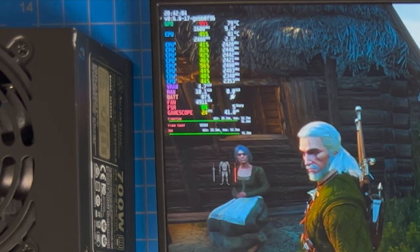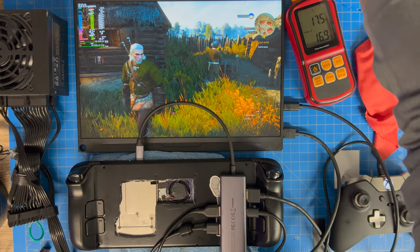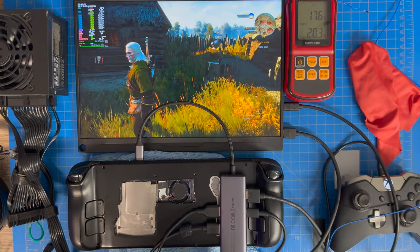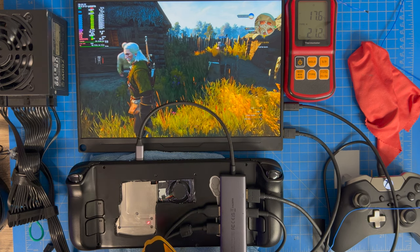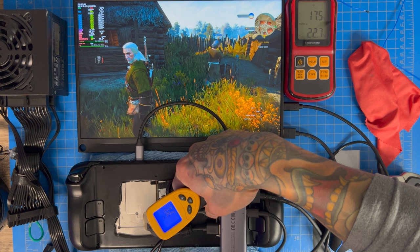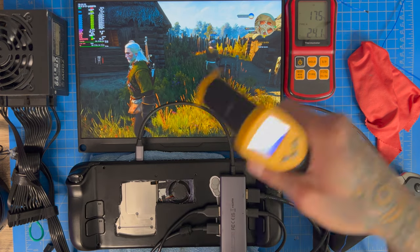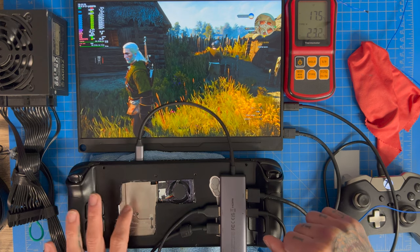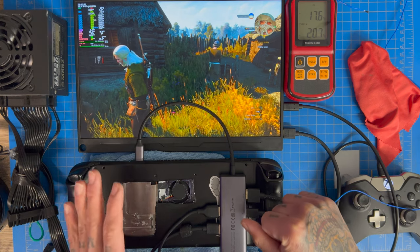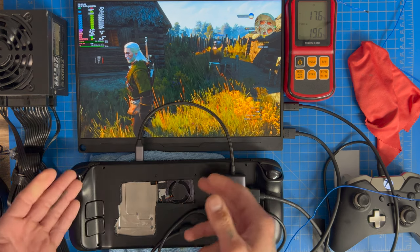We're at 81°C CPU and 79°C GPU, fan speed at 4,900 RPM. Room temp is 17.5°C. Using the thermal gun: dead center of the board reads 26°C; the hotter-running components like the controller MOSFETs and VRM are down here — hottest spot is around 44-47°C where the CPU MOSFET lives. After removing the tape and opening the back, temperatures have dropped to 69-71°C with better airflow.